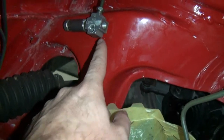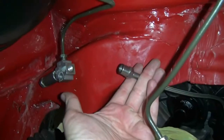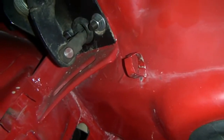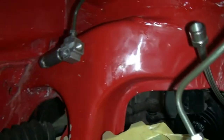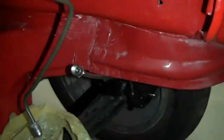So obviously there's not one in the front - it'll come from the master cylinder and basically I have a bit of pipe that'll meet up here and I'm good to go with the front brakes. And then the other one, the bottom one, is going to go all the way around and then meet up here. There's this hole here - I don't think it's meant to be there but it is, so I'm tempted to feed the brake line through that, though it's very sharp and I'd have to deburr it. The original hard lines would just tuck under here and then the brake line would attach on the inside.